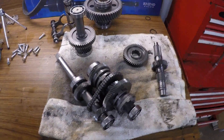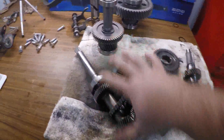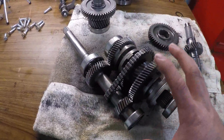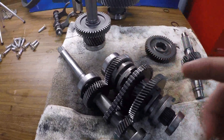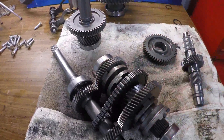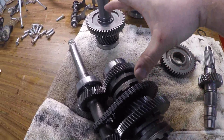To add a few more points on the difference between the Turner and Super ATV gear reductions: this is off a 2014 Razor 570, and the shaft, small gear, and large gear in the gear reduction are the exact same as the High Lifter Razor 1000 — same tooth ratio and same part numbers.